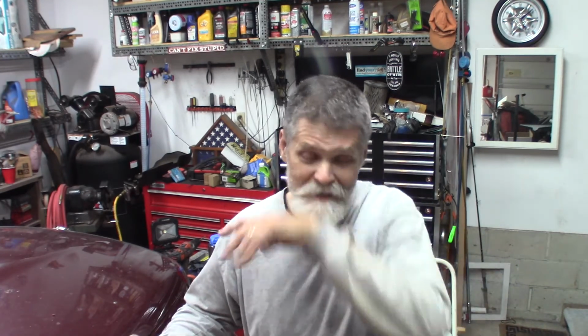exhaust, basically. It's a 140.5 inch wheelbase. It's the middle size. There's 120.5 and 160.5. The only real difference in the exhaust for this is a single exhaust, not a dual. The only real difference is the extension pipe in front of the muffler. There's a medium sized one for the 140.5, the longer one for the 160.5, and I think the 120 doesn't have one at all. I don't do a lot of exhaust work.